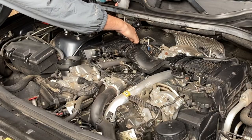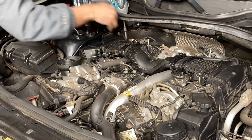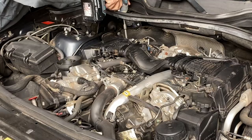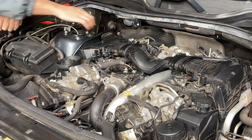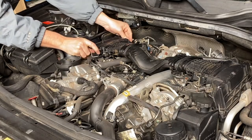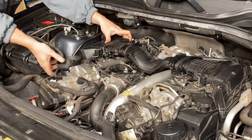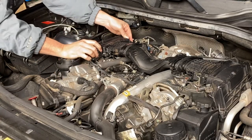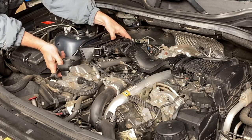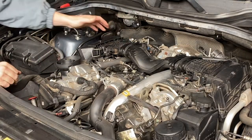Something I'll add: the earlier models of the W164 chassis and other vehicles with the OM642 engine do have a slightly different PCV valve. It's a plastic enclosure in roughly the same spot at the back left of the engine, but instead of being at the back of the head it actually sits on top of the head, so it's an easier job. Both of these valves fail - rubber diaphragms on the inside fail - so you really do need to replace them if they're somewhere between seven and ten years old and haven't been replaced.